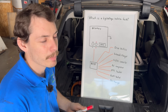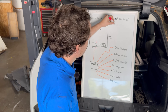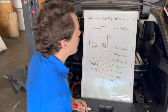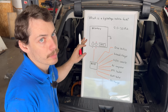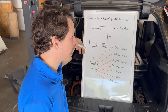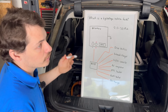What the battery management system is monitoring for isolation is the resistance between the high voltage system and chassis ground — those three little dashed bars mean chassis ground. If the resistance value is too low between the high voltage system and chassis ground, the BMS is going to throw an isolation fault. The number varies depending on the car, but most cars under typical operating circumstances are going to be somewhere in the two-and-a-half to three megaohm range — and a megaohm is one million ohms. That's usually the typical threshold spec. The minimum value at which the BMS will complain about an isolation fault varies from car to car; some might trigger down as low as 500,000 ohms or one megaohm.